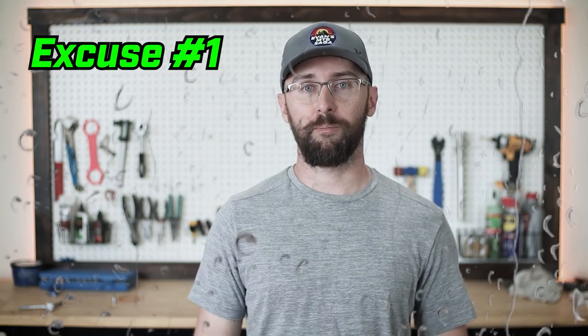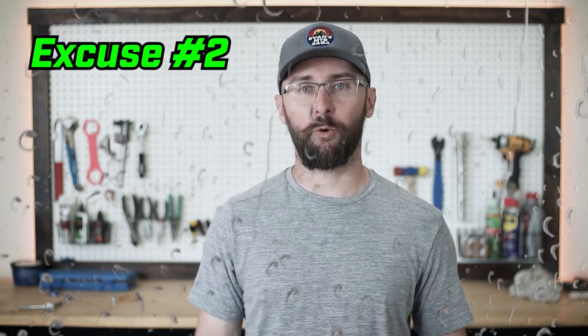After riding it, there are definitely some major areas for improvement. Normally I would have liked to flick the bike around more in the air, but it is just so dang heavy at 33.2 pounds. Other dirt jumper bikes on the market weigh about 25 pounds, so I will definitely be looking to make some wise budget upgrades. I think the forks need to be replaced right away — I had a hard time manualing the bike because these steel coil-sprung forks must weigh six to seven pounds.